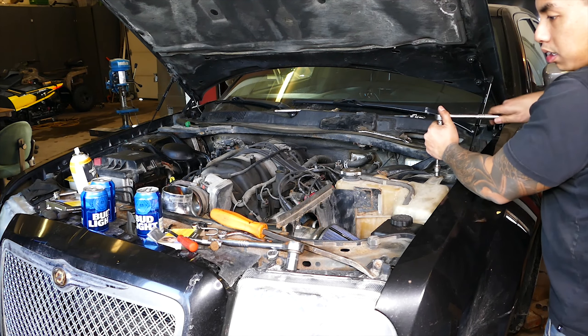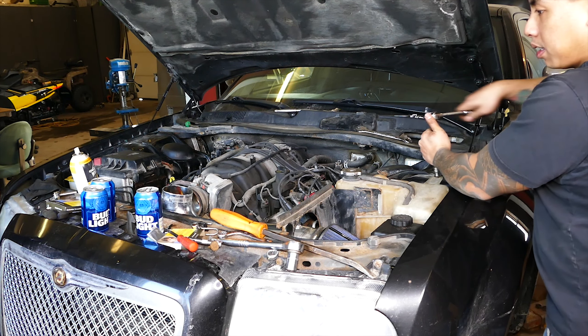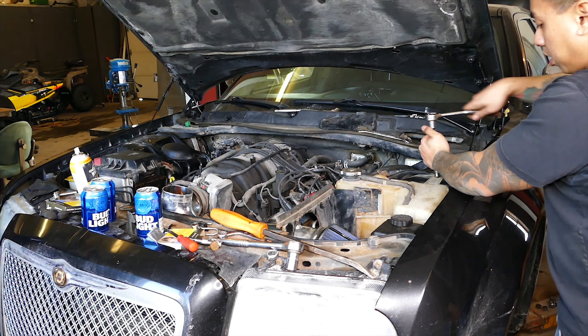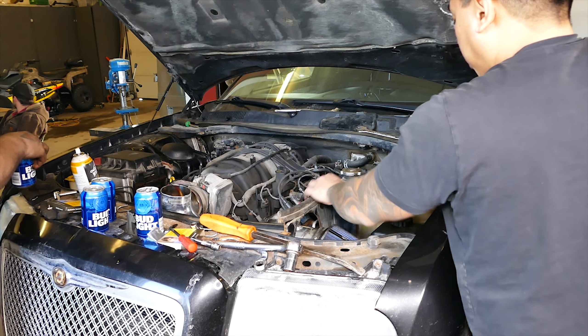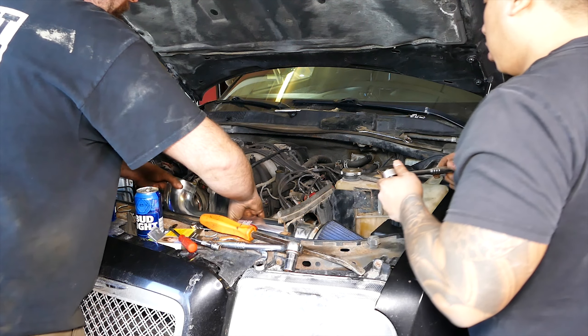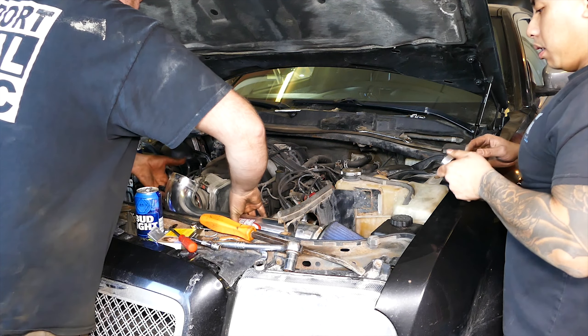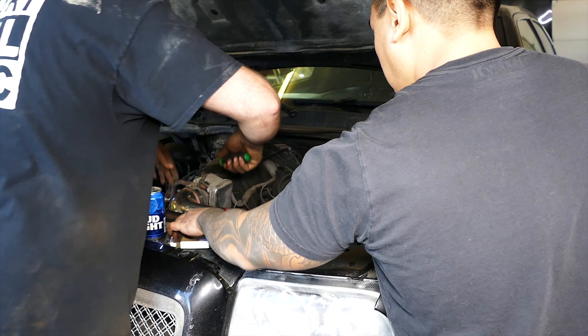Next, let's get back on top into the engine bay and install our two 18mm nuts on our upper control arm bolts and our three 13mm nuts on our strut studs and put back the plastic cover. Once that is done, go ahead and start buttoning everything back up — put back our coolant reservoir, plastic cover over the master cylinder, and install our air intake box. For the passenger side, simply put back the plastic cover that's over the cabin air filter.